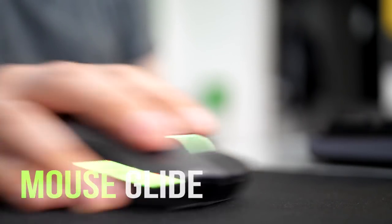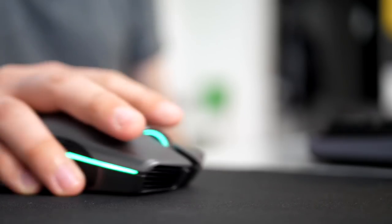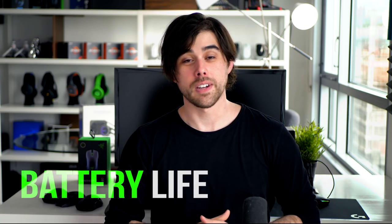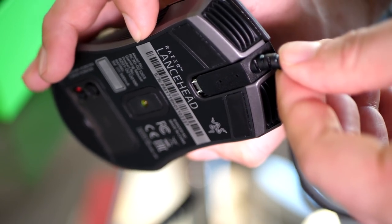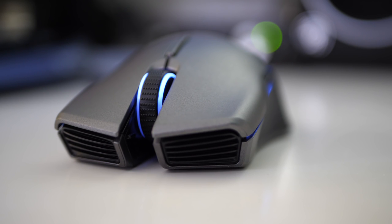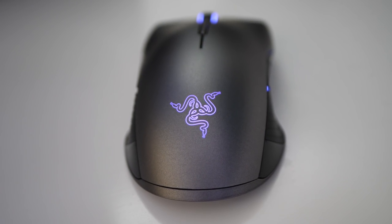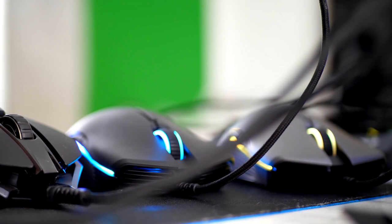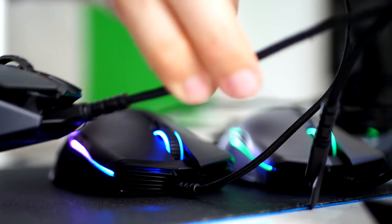The glide on all these mice is really incredible, each having large swift feet on the bottom. Now let's talk about battery life, because that's one of the fears when getting a wireless mouse. The Razer Lancehead Wireless has a 3.8 volt 800 milliamp-hour lithium polymer battery — lithium polymer batteries have a pretty steady voltage depreciation curve until a rapid drop-off at the tail end, which is great for wireless mice. The Lancehead Wireless has approximately 24 hours of battery life for continuous use, and it was charging approximately one percent per 50 seconds with RGB lighting on. Logitech's G900 uses a 750 milliamp-hour lithium polymer battery with about 32 hours continuous use, roughly 25% less with RGB on. The G403 Prodigy Wireless gets about 30 hours continuous use, all at a 1000 Hz polling rate.